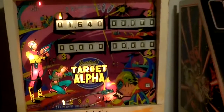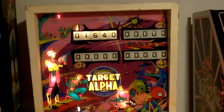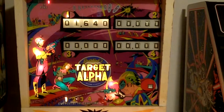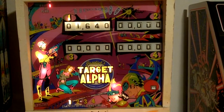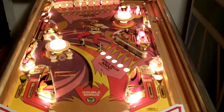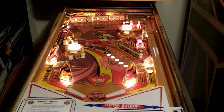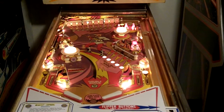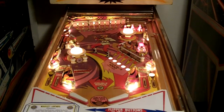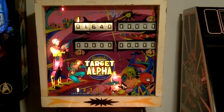So right now that's where I'm at. It's playable, it's got those issues. I just finished playing a game and the match number showed 30 on the backglass — I had a score of 20 and it gave me a credit, so I thought it was still working even though the bulb wasn't matching the match score, but evidently that might have an issue too. And the other day I started a three-player game and player number three wasn't scoring when you knock targets down. So I seem to have more issues cropping up — maybe because I don't play it enough. But that's where I'm at right now. I'd really like to figure out this alternating lanes issue. From what I read on EM machines, you pretty much try and concentrate on one problem at a time — you might cure multiple things. I'm pretty sure the alternating lanes issue is related to the match number not changing. So I'm making this video just to show my progress, show the machine, and I'll probably post it on RGP and see if anyone can help.